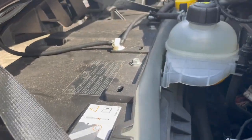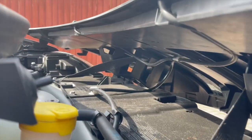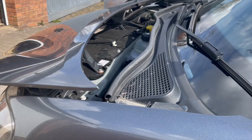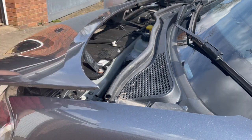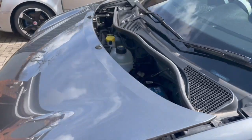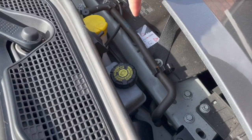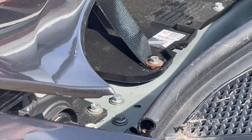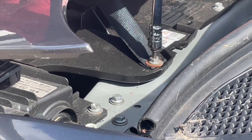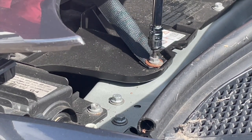Here are the retaining straps, held in by Torx bolts. There are only two — I think they're Torx 18s, but I'll put the correct size in the description box. Just giving you a bird's eye view of how little room there is in that area. It's really easy, nothing complicated — just two retaining straps, two bolts, and you need to unplug and disconnect the washer tube to the windscreen washer on the bonnet. On a scale of one to five, one being easy and five being difficult, it's really a one in terms of DIY capability.